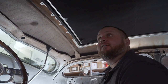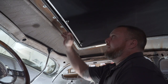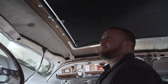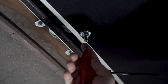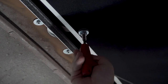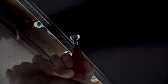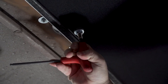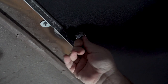One of the things we recommend during the installation setup is not using the provided handle. Actually, what you'll want to use is an allen wrench. All of our latches are actually going to be keyed with an allen socket — this allows you to work the top easier during all the installation so you're not fighting with the handle trying to get it right. When you slide the top forward, you'll notice the hook sticking out. The hook is actually going to protrude through the front of the frame, catching it on its side. You'll use the allen wrench to go ahead and drag it over, line it up, and then you'll catch the frame. Right about here is when you feel like you might break this deal — go a little further, it's alright, it's going to pop into place. It's a cam system, so it's over-centered and locked in — that's how it's supposed to be.